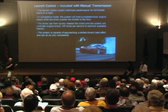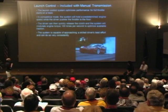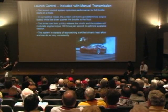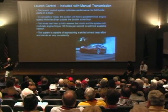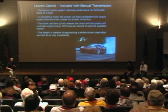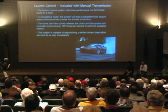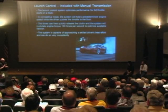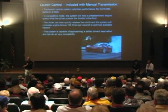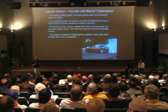The way it works is you put it in competitive mode — this really is a competitive kind of environment. Then the system, based on the car you have — because it's all manual transmission, so whether it's a base coupe or a ZR1 — depending on the specific car, it'll hold the engine RPM. You put it in competitive mode, put the throttle all the way to the floor, it doesn't go to redline, it goes to a predetermined RPM. Then all you've got to do is dump the clutch and hold on. About a hundred times a second it looks at what's happening with the slip of the wheel and makes an adjustment on engine torque to try to optimize this.